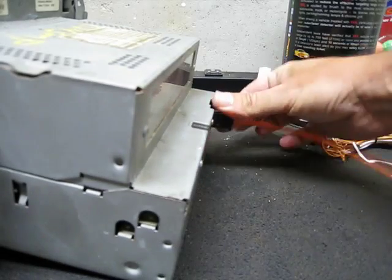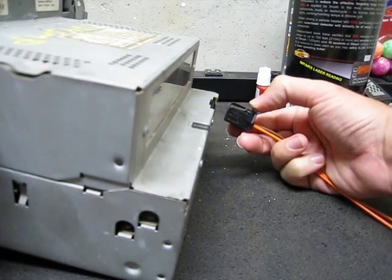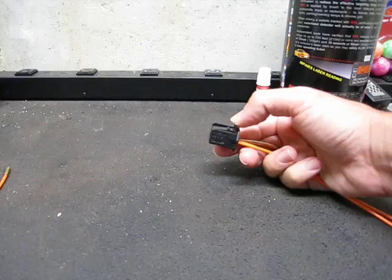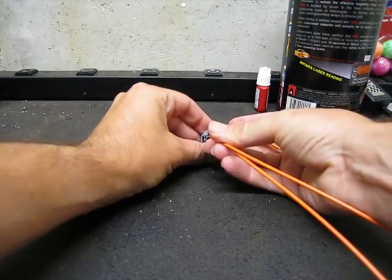In the back of every radio is one of these connectors that you can squeeze and unplug. They plug from the back of the radio and back of the CD changer in most of the E-classes and S-classes with the in-dash CD changer. The plug is actually just below the CD changer — you would see it something like this in the car.